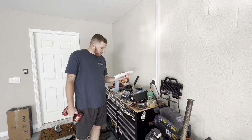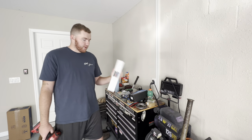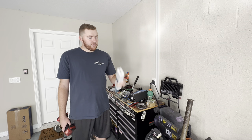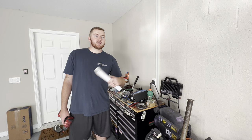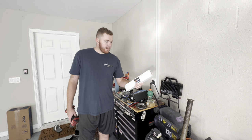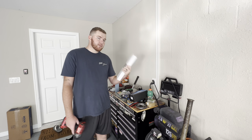I wasn't sure if I was smelling burnt clutch material, so I had my wife smell it — she knows nothing about transmission fluid — and she said they smelled exactly the same. What's on the dipstick is a little lighter pink and thinner, but it's not burnt whatsoever. I did some research and found a forum saying your third brake light can go out and cause your torque converter to lock and unlock. Sure enough, reviewing security footage of me leaving for Thanksgiving, my third brake light doesn't work.